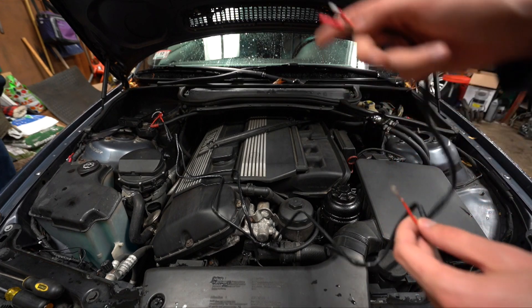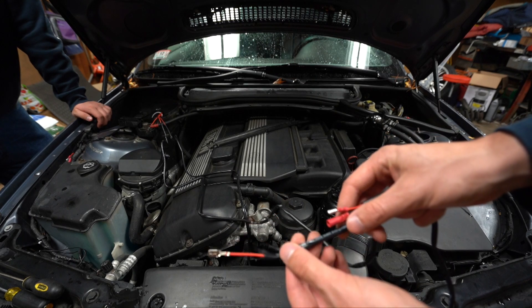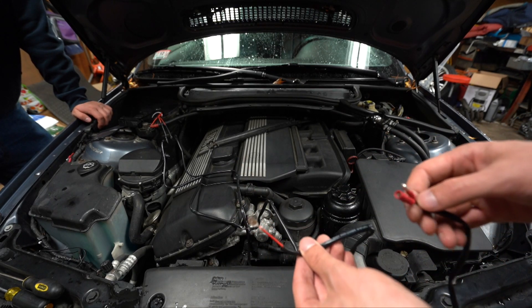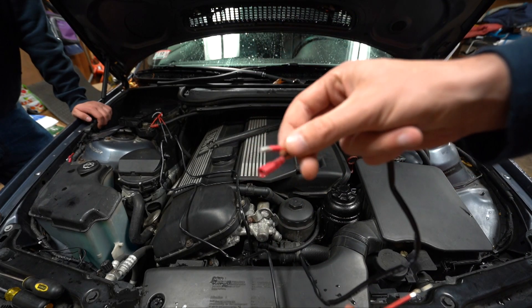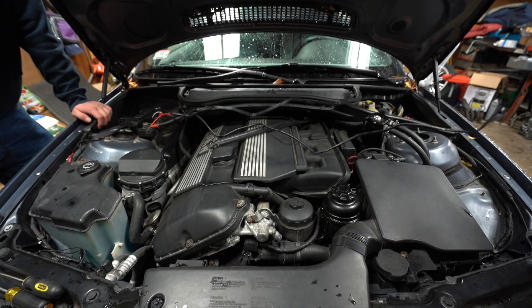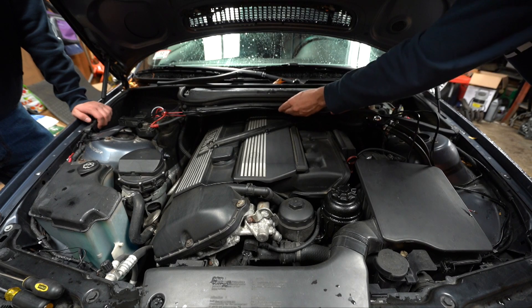The white cable runs to the inside of the cabin. The single black spade connector — the coated black one — is the one that goes to the DME. The long one with the negative and positive is for the right side angel eye, and I'm going to run it up where the positive lead goes.